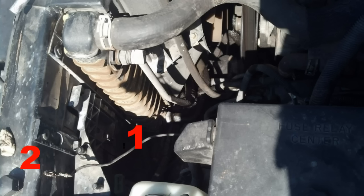If you look at this picture here — I forgot to film when I was doing this, I just got into work and started working — but I'll mark this picture up where the bolt comes in on the radiator. Wire number two is the wire coming off the ECM module, and down there at mark number one, near the bottom by the radiator, that's where the bolt was all rusted. Here's a close-up of the bolt attached down there — just a couple inches off the bottom. You can see it's very highly corroded. I went ahead and worked on it, cleaned the whole area with a wire brush, and put some liquid tape over it to seal it up so it doesn't get messed up again.